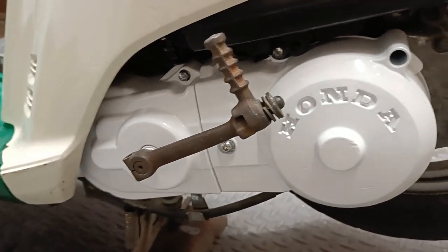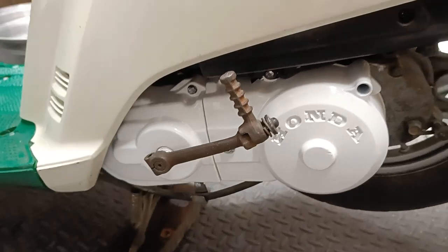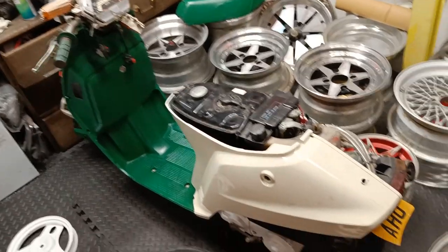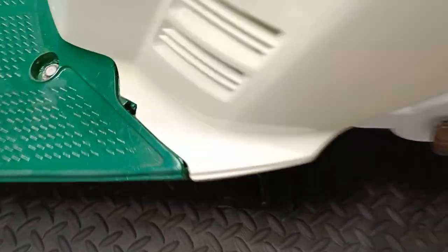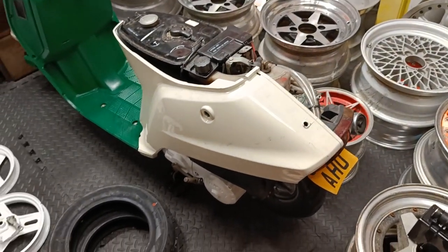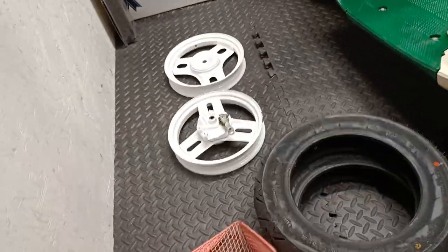This is why you need to use petrol-resistant lacquer, and I found out that powder coat is actually chemical resistant too. It's still a bit busy in here but there's been some progress. The panels are off at the painters. There are some spare panels that are a bit mashed up - bits missing and the tabs are broken, so these are probably just going to go in the bin, though I might take the vents out and use them on the next panels.